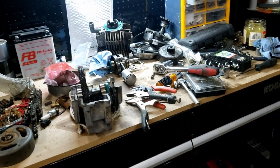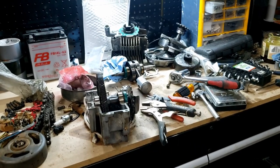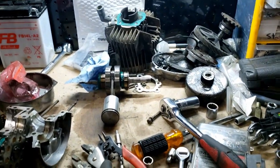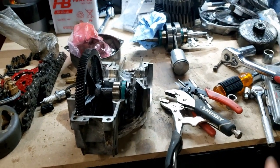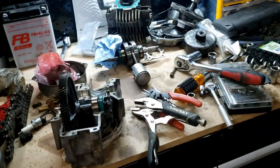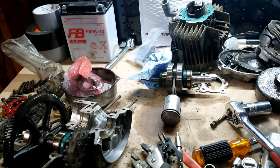This bike was reassembled. I even took apart the stock exhaust and cleaned it out — I had to do the trick where you put a broom handle in the exhaust and pound out the inner baffle. So exhaust was clean, there was going to be no dirty exhaust. We have fat spark. The carb is the original 12 carb mated to a 14 intake. Just in the interest of time, I had a clone 15 Bing that I put on there with an appropriate size jet — a low 60s jet — just to get this thing to run. The spark plug was plenty wet and the bowl was filling up; I had fuel. I had spark. I had compression with my nice new piston in the top end. I even put a Harbor Freight compression tester on it and got 60 PSI, just like all my other bikes that tester reads low for. But yet, it wouldn't run and it was driving me insane.